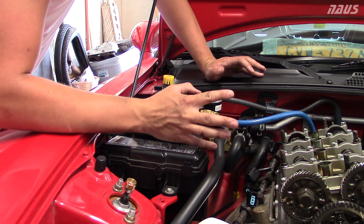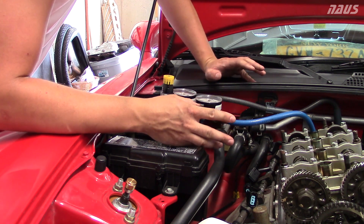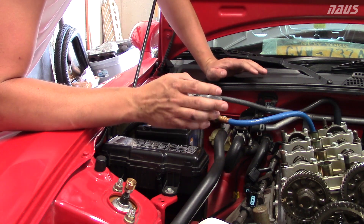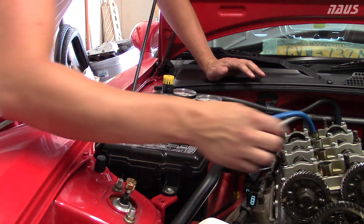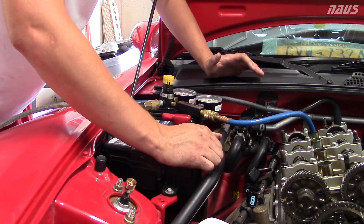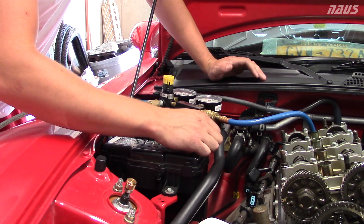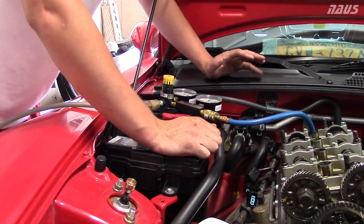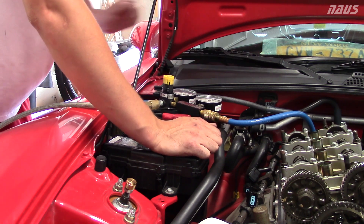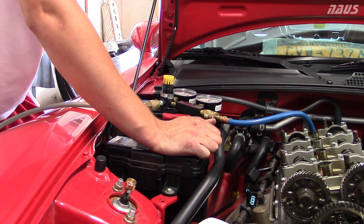If you do hear those sounds, don't be alarmed — just double check that your engine is on top dead center to make sure none of the valves are actually being opened by the cams. Follow the cam gear markings; I follow Rob Ribbonette's forum on this and I'll put the link in the description. I just wanted to give a quick look at how it actually looks on the car — this cylinder has 3% leak down on a cold engine, which is a very strong number.